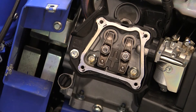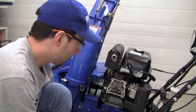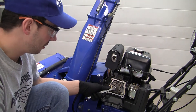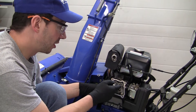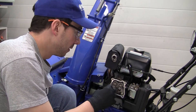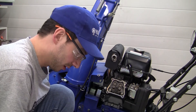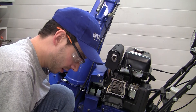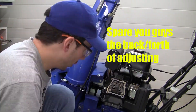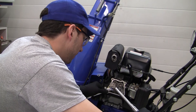The instructions on making the adjustment are in the service manual. I've read it — it's pretty direct, much simpler than the motorcycle. Essentially just loosen the lock nut and then turn the adjuster to get the clearance to change. So now with a 14mm, we lock the adjuster in position and then loosen the lock nut. Screwing in the adjuster would bring the clearance down, which is what we need to do. Since we want to aim for 0.1mm clearance, I'm going to take out the 0.1mm feeler gauge. Now confirm we've got 87 inch-pounds and we perform that tightening.